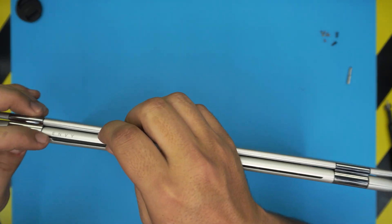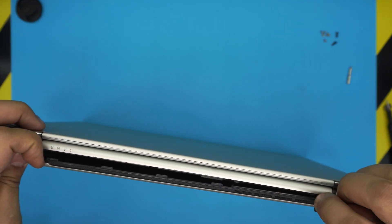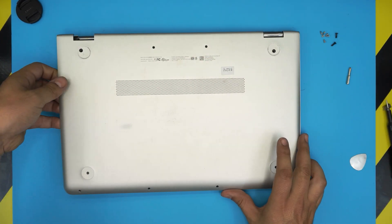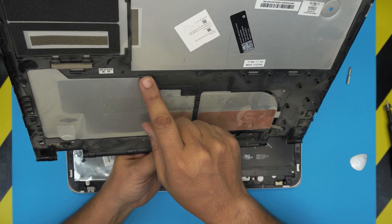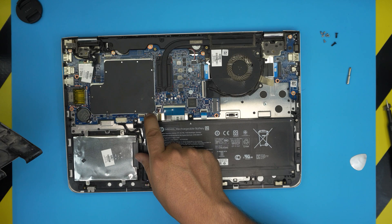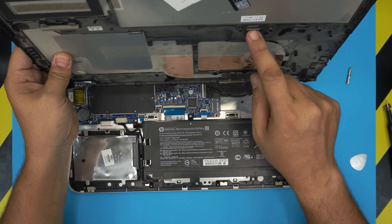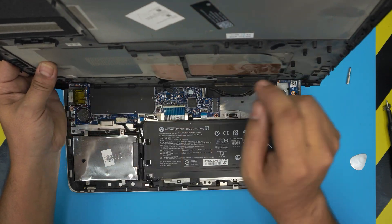You can try the back end by the grill — right at the bottom of the grill. Once you've done that, grab the top part. There are a couple of tiny hooks in the middle — you need to pull really hard on them to release. Grab it from here and wiggle it around and pull up to release those hooks. There are two of them — one grabs from here, one grabs from there, and there's a support piece that doesn't grab anywhere. That's the bottom cover — bottom chassis.